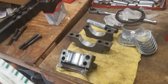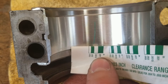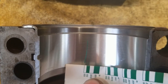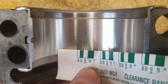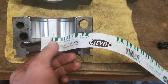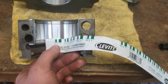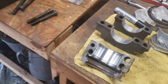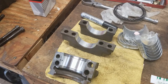You have to line this up on the gauge and it should be squished out to one of these thicknesses. Basically, as long as it's in the range of one of the two middle ones, it's fine. 0.003 is getting to be a little bit too much clearance; 0.001 is probably not enough clearance. You want to be right in between — 0.0015 being the least amount of clearance and 0.002 being the most clearance. Don't go over 0.003, at least as far as what I've seen — but double check that yourselves because we're not professionals.